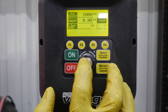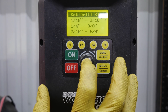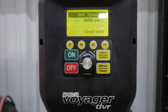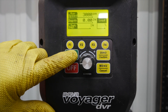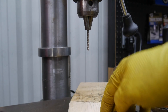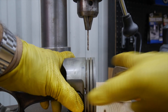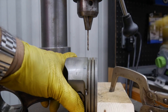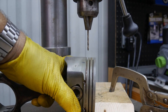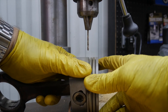Set the drill press. Go to the menu — twist drill, less than three-sixteenths, aluminum. Confirm. All I've got here is a piece of two-by-six with a V-groove notched in it. You could take two pieces of wood and put them on either side, or use a vise with soft jaws like aluminum or wood. This notch lets me hold the piston from rocking so I can set it on the skirt, hit that mark, hit that mark, then flip it over and hit the others. Let's get this one ready.